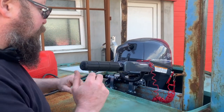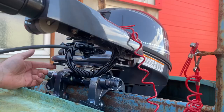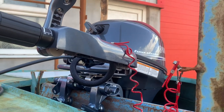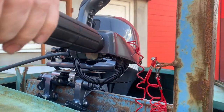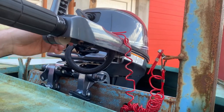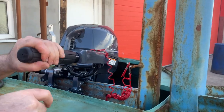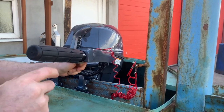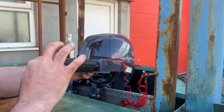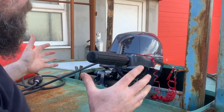The other couple of little things are the friction control devices. The steering friction — if you push that over you'll see it kind of locks the steering up; it's not absolutely locked but it would be dangerous for it to be fully locked. And just here, there's a throttle friction adjuster — if that's undone, the vibration of the engine will cause the revs to drop. If you just tighten that up a little bit, it allows it to stay in position. So that's all the checks done.